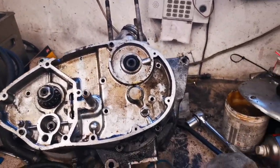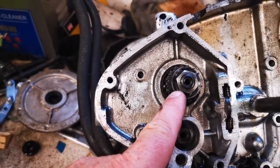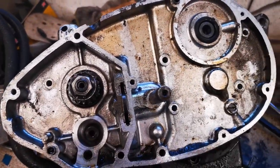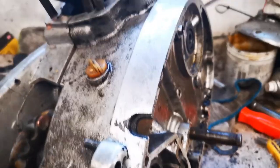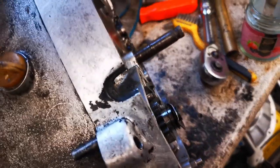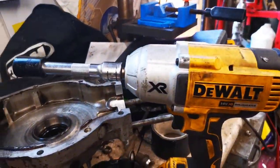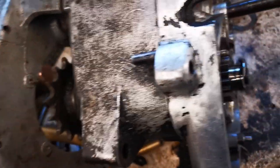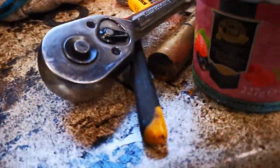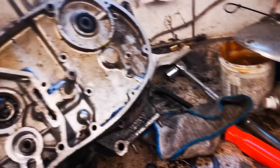So I'll flip the engine over to the other side — I've taken all the screws out. Now I need to undo this little fella here, take the tab washer out, take the nut off, bring the gearing out. So that's off now. The way I did it is I put the socket back on the other side because obviously this thing's spinning, then I wedged it using the brass drift, and then used the rattle gun on the nut while that's locked off. Job done. That's everything off and in the jam pot for safekeeping. On to the next bit.